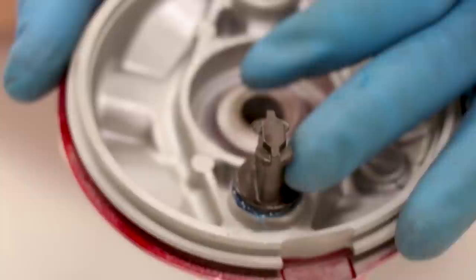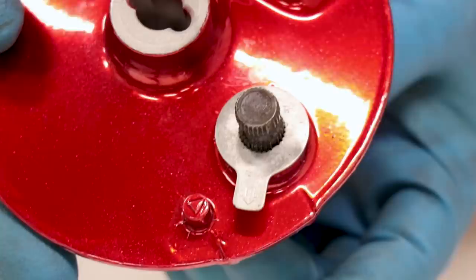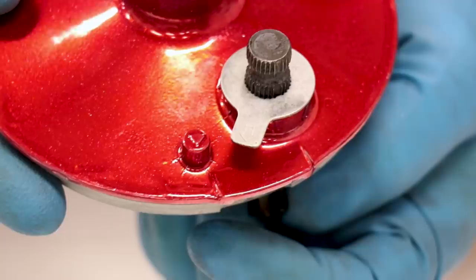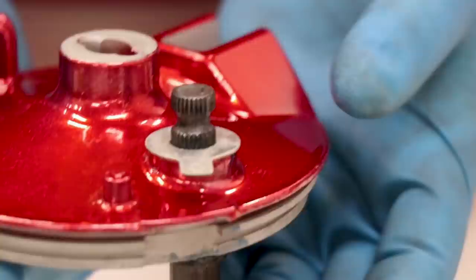The shaft can go two different ways — basically we need this to be lined up with the pin on the other side, and you want the arrow closest to the indicator on the panel. So basically that arrow and panel marking indicate brake shoe wear: when you pull the lever, if those two line up it means your brake shoes are too worn and you'll need to replace them. It's a nice little feature Honda added that I don't think a lot of people realize.